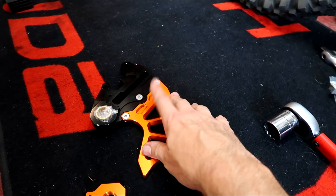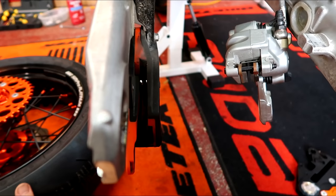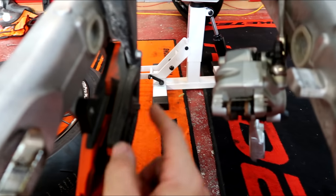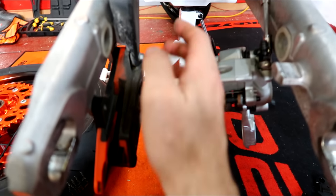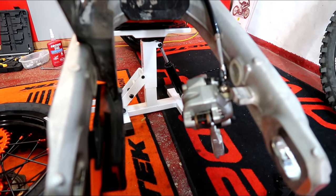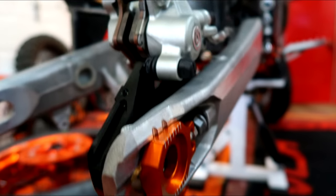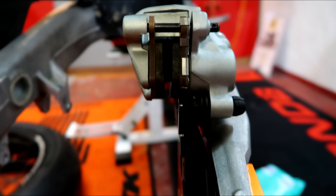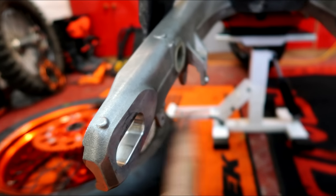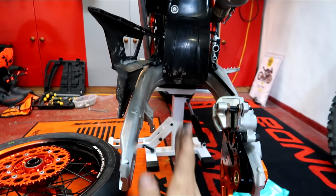Spacers in. I've also got some bling — a rear disc protector and bling. These wheels are really wide and hard to get in without scratching the hell out of them, getting them past the caliper and stuff. So I'm going to remove the chain guide here and maybe take the whole chain guard off — take as much out as possible to make it as easy as possible, because it's a pig. New fancy pants things fitted, Mud Pig Racing bling-a-bling blings. Brake pad secured, pads in — they can be a pain with pads falling out as you're trying to do this. I've taken off the chain guide and moved things over a little bit so I've got the clearest run possible to get that wheel in.